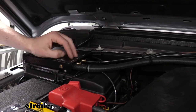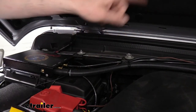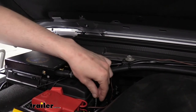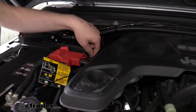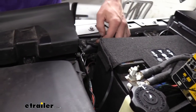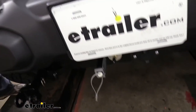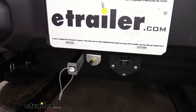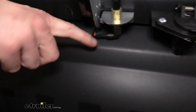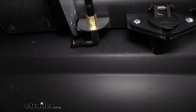We can now go back to our operating unit and focus on getting the rest of our hoses attached. We've got the air out going to our cylinder inside. Next we move to our air in — we need air coming into this unit to activate the cylinder on the pedal. This routes down and around the battery for a safer path, then around the air box, down to the front, and straight down behind the frame. We drilled a small hole in the under shield and poked the airline through, attaching it into the quick connect on our fitting at the front.